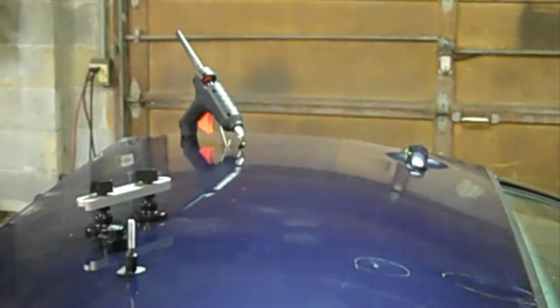As I pointed out, that dent there looks pretty heavy. It's still kind of shallow, and normally I would probably heat it or spoon it from behind, but there's always a possibility when you get a dent like this that you've got too much metal in the door, so you can pull it out, but then you're going to have it popping. So what we'll do is we'll use my puller. This is a paintless dent puller.